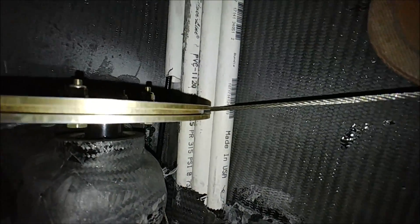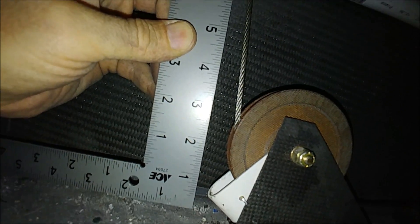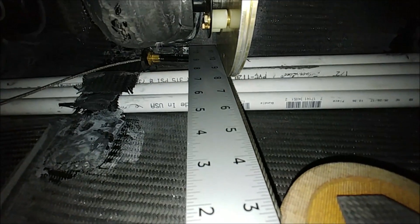Looking into the fuselage in the keel here — if you freeze frame it you can see the alignment isn't right from the pulleys on the floor to the one attached to the center stick. Because of it, it's sort of grinding on the pulley. As you can see, the cable should have been coming straight towards the camera, and holding a ruler flat up against the wheel you can see we're out by about a half inch. The fix was to put a spacer in between the back end of the pulley bracket and the actual pulley itself — some FR4 spacer blocks and a steel spacer in the middle.